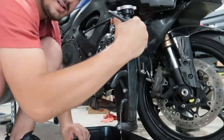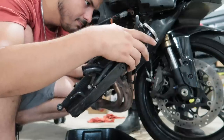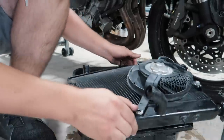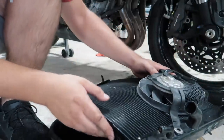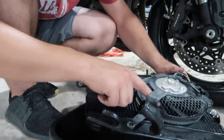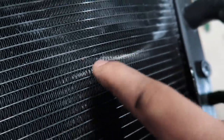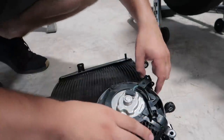We got the radiator out of the bike - let me let it drain a little bit and see if we can find where the hole is. Right here where the fan is - this looks like an aftermarket radiator, and on aftermarket radiators on bikes sometimes fitment isn't right. The fan is detrimentally close to the radiator, and what happens over time is whenever the fan kicks on it will eventually cut through the radiator slowly but surely. Check it out - it barely ever so slightly cut through the wall of the radiator right where the fluid passes through.